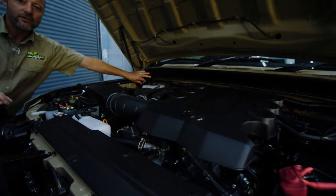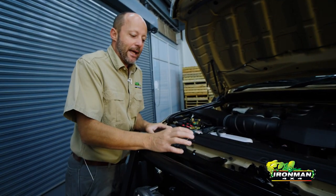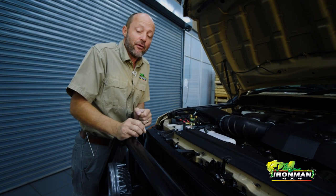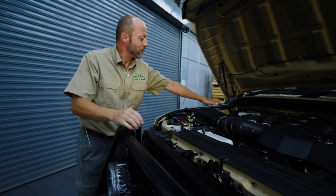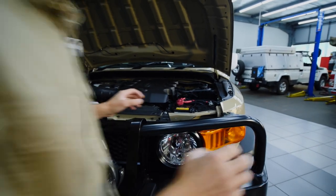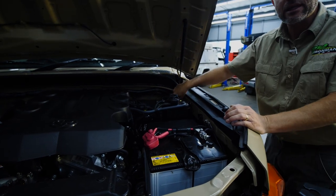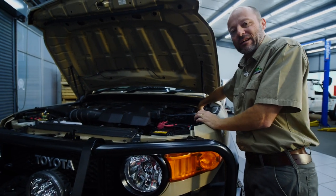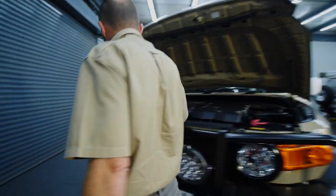This is the breather hose and breather stone from the winch motor. So if you've been winching and it's hot and you dunk into an ice cold river, it wants to then suck some air from the outside into the motor, and if you're underwater, you'll suck the water in, of course, but with a breather like that, you prevent that from happening. And exactly the same with the differentials of the vehicle. So this green hose over here and these two little breathers here are for your front and your rear diff. So from the front and the rear diff, brought to the top here, dunking through deep water, you're not going to be sucking water into the diff of the vehicle. Very important. Let's have a quick squiz on the inside here.